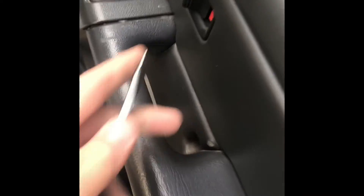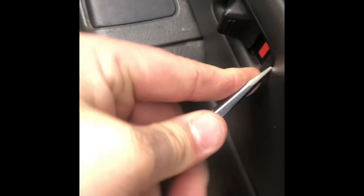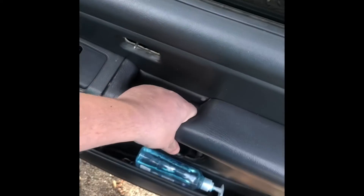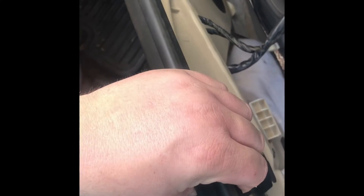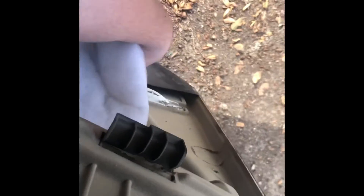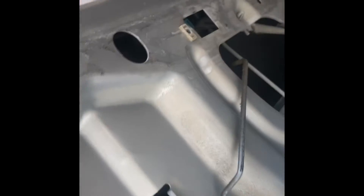Actually, it's a Torx screw. Before I pop the door panel off, we're going to take this little lock button off — it just pops out. It's easier if you have a proper tool, but I just have a flathead. Then lastly, you should be able to grab the door panel by the handle and pull up. Now that the door panel is off, there's a light connector right there for the door switches, and of course my turn signal mirrors connector right there. I'm going to pull the door panel light off, then turn the panel and let it sit like that, as long as you have the door light out. Now we need to pull this plastic panel back.